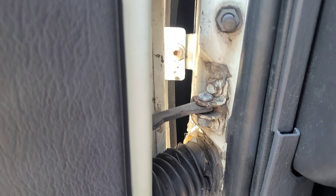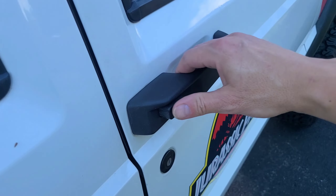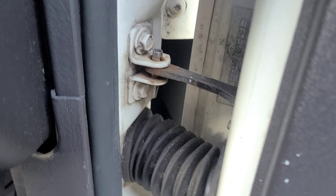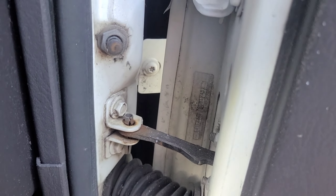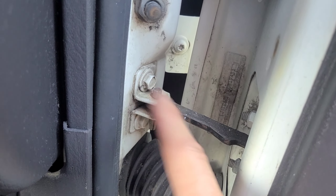It's so annoying, you probably didn't hear me over it. Now the other door also does it. That one has the factory pin, and as you can see, it pops and moves around because over time the hole that the pin goes through will wear and enlarge and doesn't fit properly anymore.